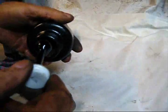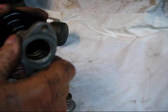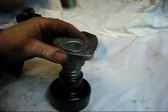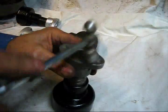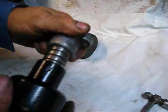And the muffler part, we don't want this to come off. You say, how are you going to disassemble that? Well, if it ever comes the time to disassemble it — the stuff smells pretty good too — you just soak it in some lacquer thinner and it'll dissolve itself. When you get it screwed together like that and put your insert in there, this is actually a really good fit on this one. Surprising how good that fits — really nice all the way through there, real smooth. Now the gasket will go here and you'd bolt that on the engine.